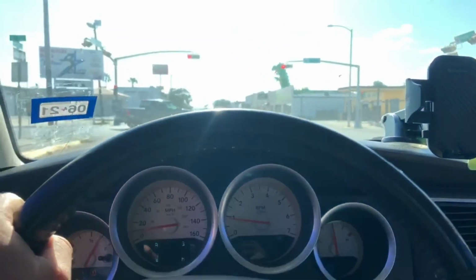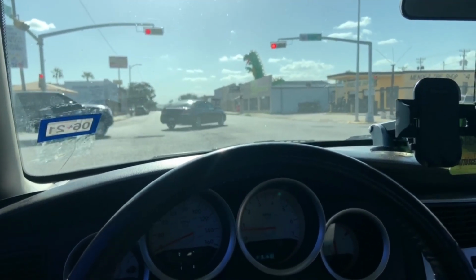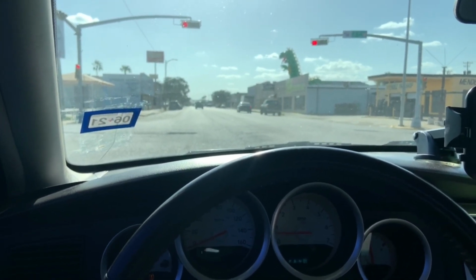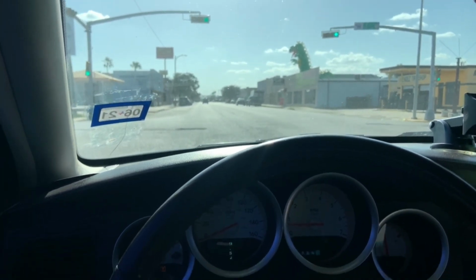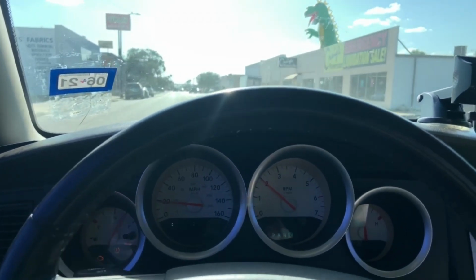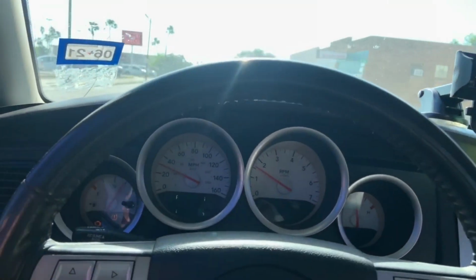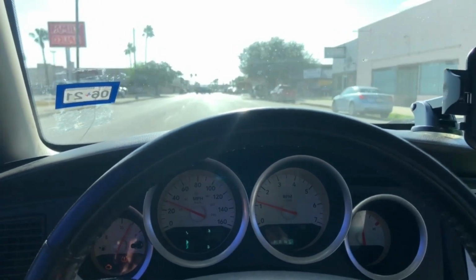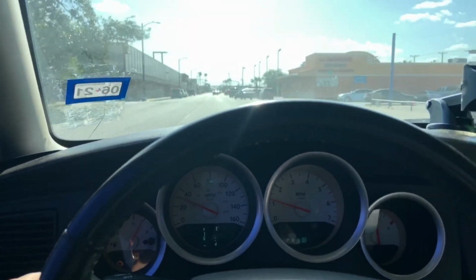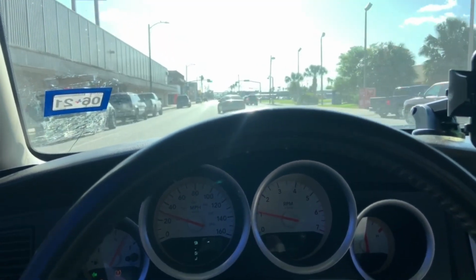And then a fun fact about having worn coil pack boots is that your car, well, one, it's gonna be shaking. Kind of feels like if it's cammed in a way. Not really, but somewhat. And then the other thing is that it'll lose power, guys. It loses power, and you're also robbing it of the gas mileage. In reality, you shouldn't even run the car when this happens, because you could cause damage to the engine.